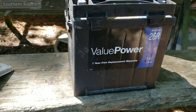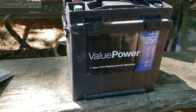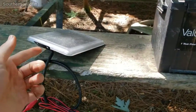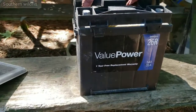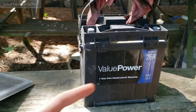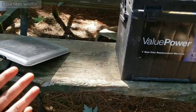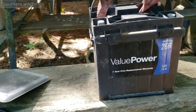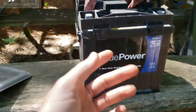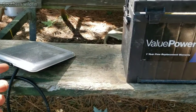It's been working great for me ever since I got the battery — and with my old battery before that too. That's the way I do it: a solar panel sitting in the sun, hooked straight up to the positive and negative terminals on the battery. Hopefully that helps somebody out, because I don't know if anyone's ever thought about doing that. I just use a little solar panel, hook it up, leave it in the sun, and it keeps it maintained.